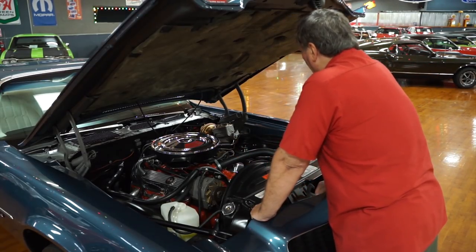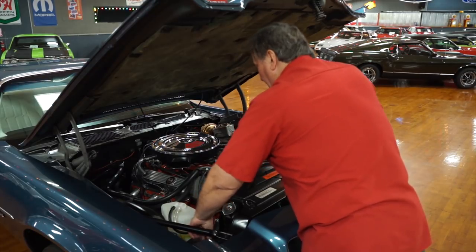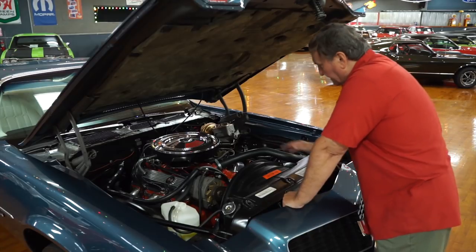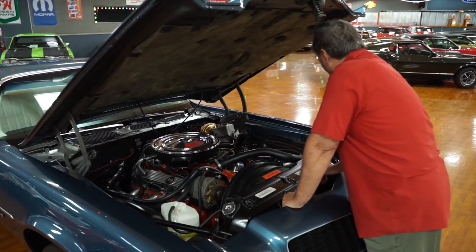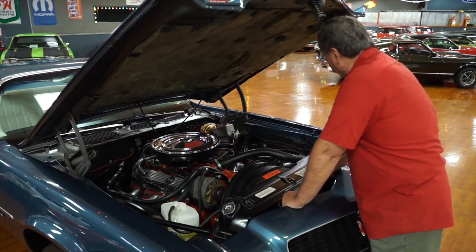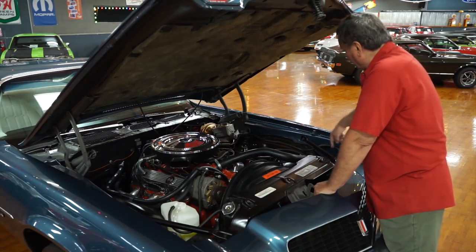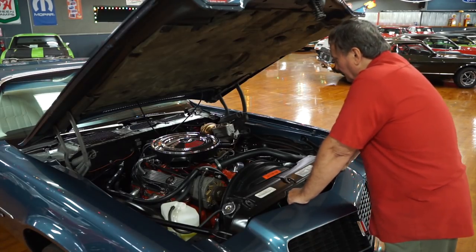All the brake lines are stainless steel with the wire windings on them, just the way they should be from the factory. Everything is just new in this vehicle — everything. It has a Delco-style top battery — a modern design, but with the top that designates it as Delco original equipment style. Fan shroud the way it was from General Motors, high-flow radiator, flex fan on the front. All the hoses are still intact for the smog vapor system mandated at that point in time — all vapor from the gas tank runs into this carbon canister that supposedly filtered the impurities out.